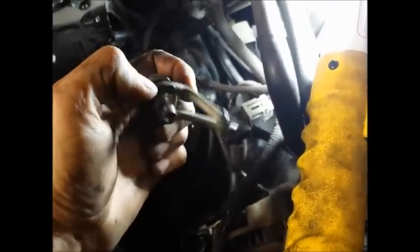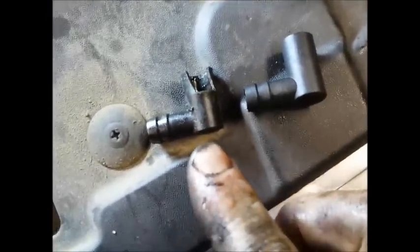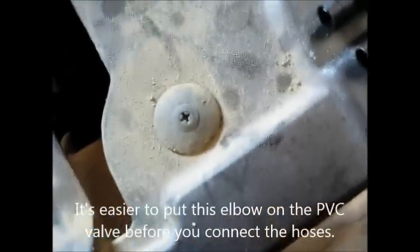I discovered when I was putting it back on that the air tube is on top. This little bracket here — you can see that little bracket is one that goes in there, but this one here is broken. I don't know if it was that way before, but when you're putting it back on make sure you use one of the new fittings out of the little box. Looking at them I can see which one is the match — right there, you can see the brand new one versus the broken one. Make sure you put the right one back on, make sure it fits — looks like it does — so we'll stick these on there and that should fix the problem.